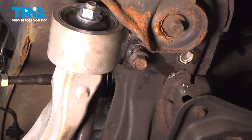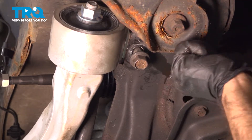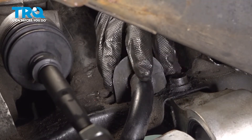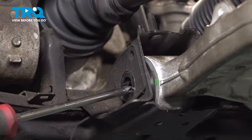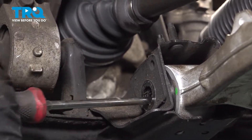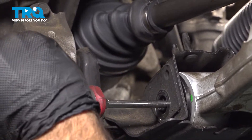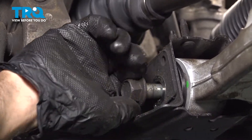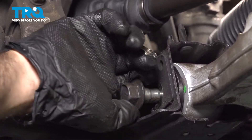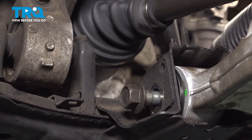We might be a little misaligned — we definitely are in the back. Now we can put our top bolt in. Our front bolt is misaligned, so we're going to use a screwdriver to move that control arm a little bit, and then we can put our bolt in place. We still have our front ball joint loose; we're not going to tighten this down, just get a few threads going.